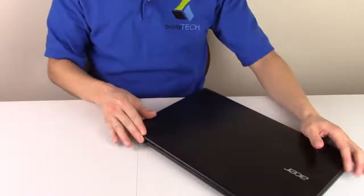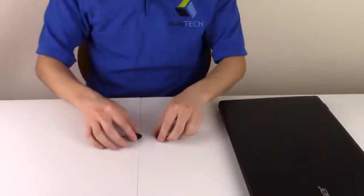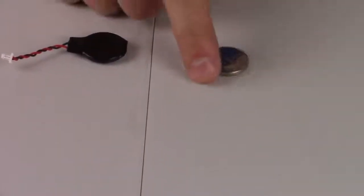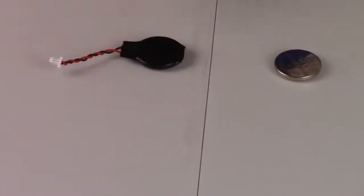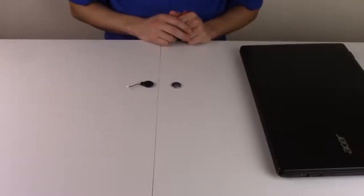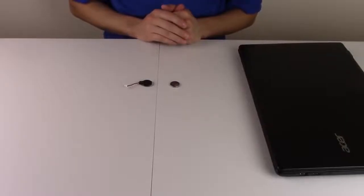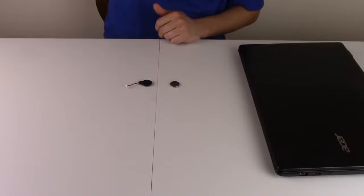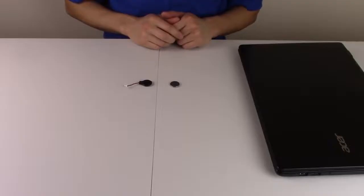Every laptop has on the motherboard what's called a CMOS battery. They will look something like this — you'll only have one on your motherboard. It will either be a loose battery, kind of like a gigantic watch battery, or it will be that same battery just wrapped up with a plug. That's what we're going after when we get inside this laptop. This CMOS battery supplies power to the BIOS, or your base system, even when your machine is turned off. We're going to remove this battery, which will cause BIOS to reset to factory settings, which can sometimes help your computer to revive when it's entirely dead.